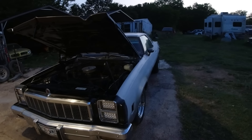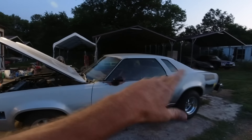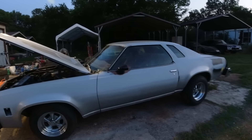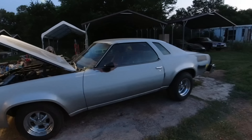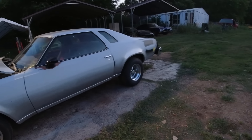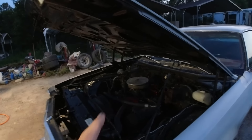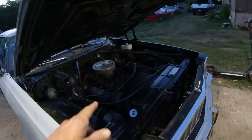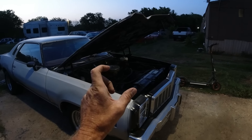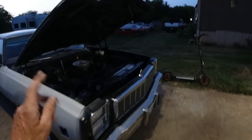Plus it's probably old gas. Ten years ago when Dart brought me this car, I took out the gas tank and dumped it, then when I finished welding the trunk I put in the gas tank and five gallons of new gas — that's now ten years old. I just mixed in five more gallons of good gas. It's not smoking so I don't think it's got too much bad gas. We'll probably also have to redo the fuel line and put a see-through filter on to check how dirty the gas is.